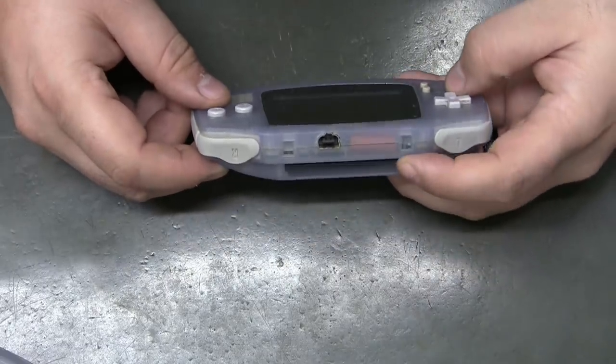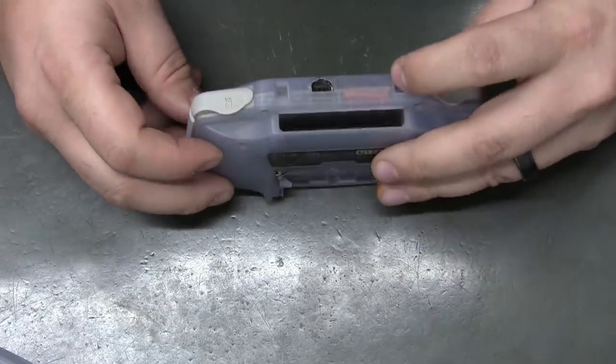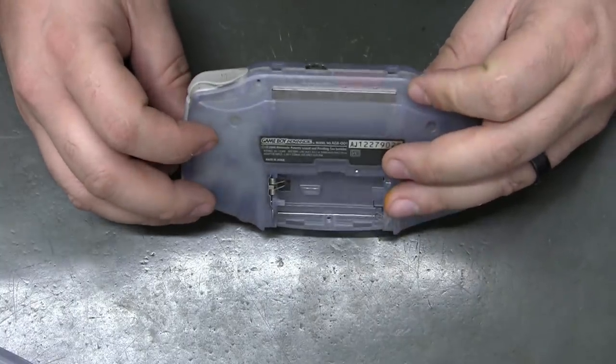Okay, one of the very first things that you want to do before even ordering a kit is to figure out if you need a 40 pin or 32 pin version of the kit. 40 pin is standard, and you have to buy an adapter PCB for 32 pin.